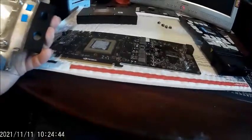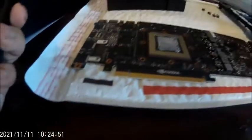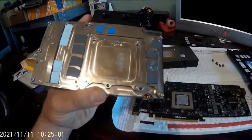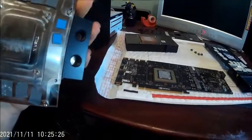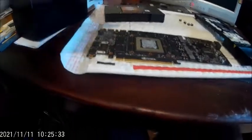Because the M40 is based on the Maxwell architecture, it's essentially a GTX Titan, but it's a Tesla card, so it has no video output for monitors. I just wanted to pull it apart and see if the GTX water block would fit the Tesla M40. From my understanding, it should — it has everything there for it to work. I just got a chance to put some of the pads on the water block. The only thing I still need is the fittings for it, so we'll have to find some fittings and then whack it on. It should cool this Tesla card.